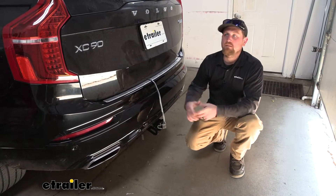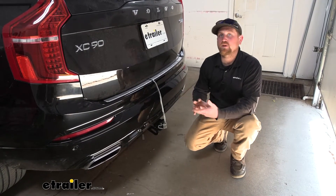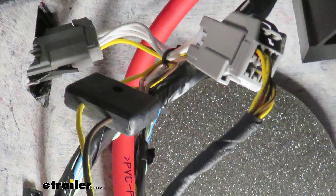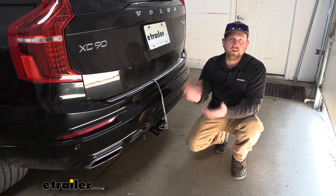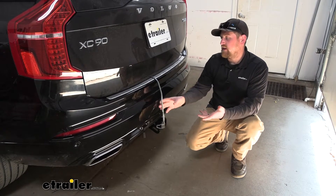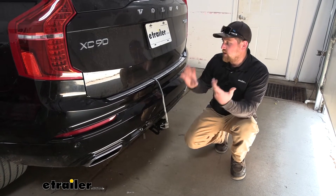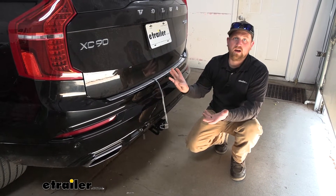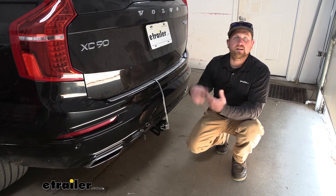As far as the installation goes, you might think it would be relatively complicated, especially on a vehicle like a Volvo, but actually that's not the case. It's pretty straightforward. This kit uses T-connectors, so it just plugs right in more or less. You do have to hook up a power and ground to your battery, but the good news is the battery is here in the back and really easy to get to. You can do this installation at home — once you have this kit on there, you're not going to have to get your car reflashed or reprogrammed. Once it's on, it's going to work and get the job done.